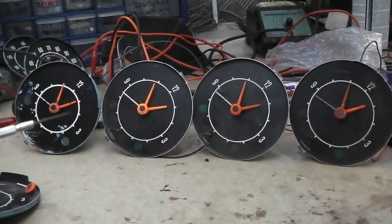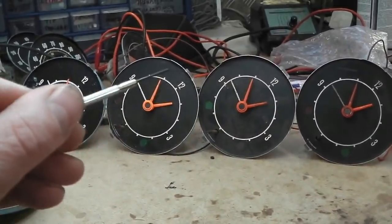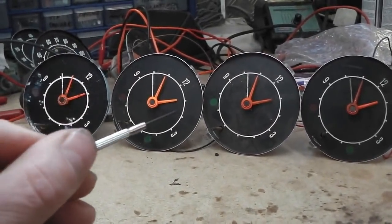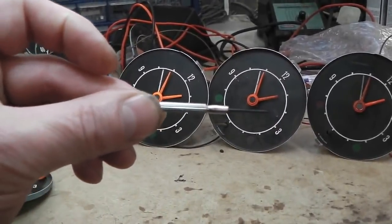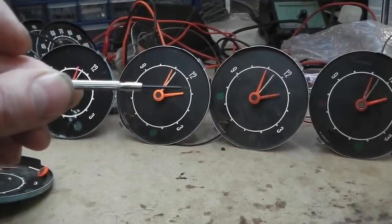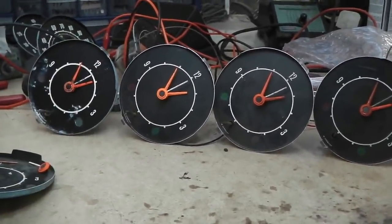So when I say phase shift, if you've got a waveform, sort of bumps on a waveform, and all the waveforms are in the same pattern, then they lay on top of each other and you can't tell. But if one's ahead, you get a bump, and then immediately after another bump, because it's not quite sitting behind it, like shadowed behind it, if you will, and you can hear that in the sounds.